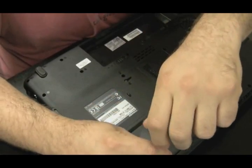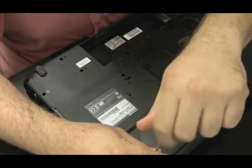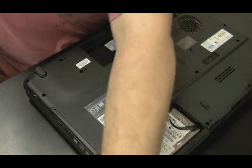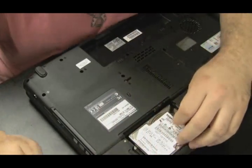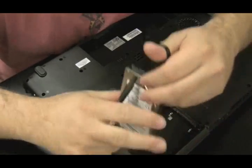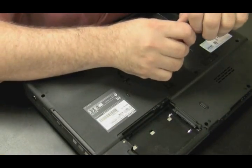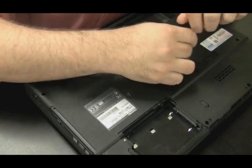I take the battery out first. We take out the hard drive and all the other components second. And then we unscrew the case and get all the screws off the bottom part of the case. See if there's any screws in the top part of the case. So we get the hard drive out. We're going to take the RAM out.